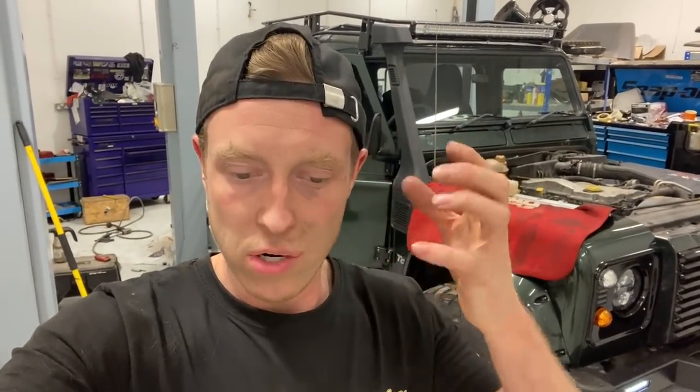And we've also done the front and rear diff pinion seal, which means that all we've got tomorrow morning to do, it needs an A-frame ball joint in the back to stop the axle rotating. The gator looks a little bit worn, so we can change one of those. We're gonna give it a full service. I'm gonna focus on doing the window rebuild and getting those windows tinted. We're gonna change the LED light bar, fit the winch.